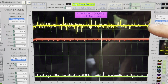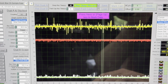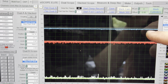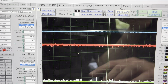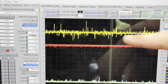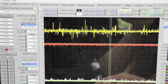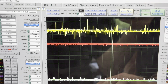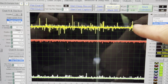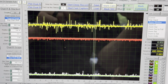There's our sense wire. Here is our cable going in. Remember that the blue is on the battery and the yellow is at the alternator. It's noisy at the alternator — I get that — but that's not a problem. That's just a voltage drop. I'm just looking for — if this was up here and this one was down lower, that would mean we'd have a voltage drop between the two — but we don't. So we're good there.